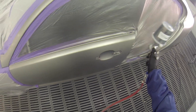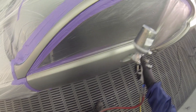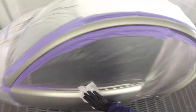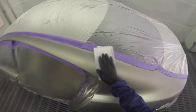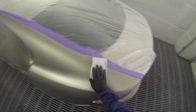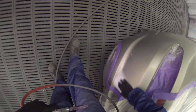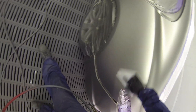You'll see I'm only putting the paint over roughly where the repairs were for that first coat — just to save material. There's no need to put paint further across the panel unless you're blending it out, and we've pretty much already blended it out anyway. That double coat there was just a bit more over the repair areas to make sure we've got coverage, and then the rest was finishing touches of blending out before I put a technique coat down.